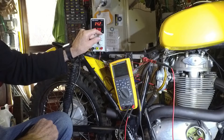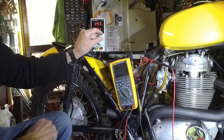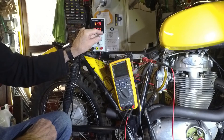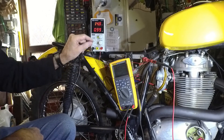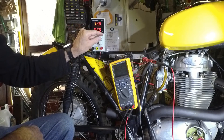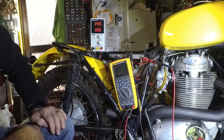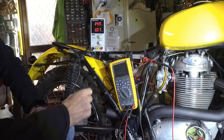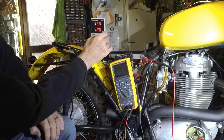This will be going through the Zener diode. At 14.5 on here, this is where it starts to go wrong. So this is 14.8 versus 14.5, 14.6. We're up to an amp — so that's 12 watts going through the Zener. The Zener is starting to collapse; it's reached its threshold and it's starting to pass current. It should be dissipating around 15 watts.